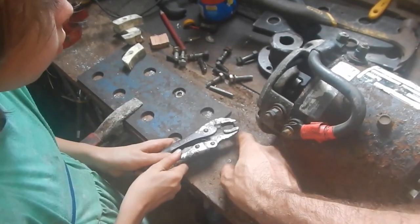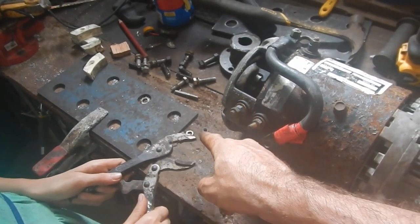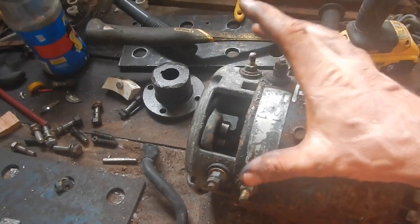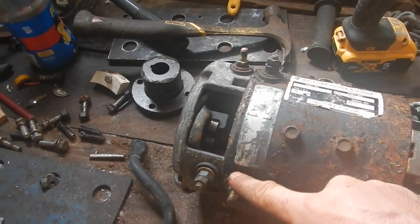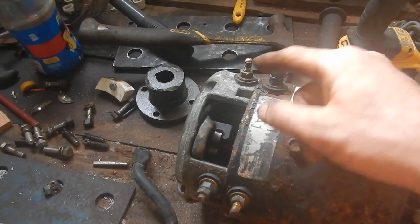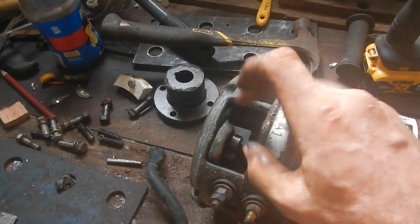Make sure you don't lose that nut, keep it right here. Take off this little washer and get the cable off. You guys have to be really careful doing this stuff — you don't want to lose these. These are brass; it wouldn't be easy to replace. Okay, we've got some little labels here. We have four contacts. This says S1, S2 — I think those are for the stator, which is the part that doesn't rotate, the electromagnet in the housing. And then A1, A2 — I guess that's armature. I'm pretty sure this is the electricity that goes into the brushes, which would make sense; it's on the piece where the brushes connect.